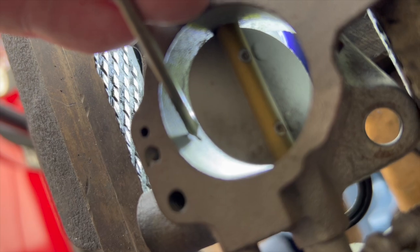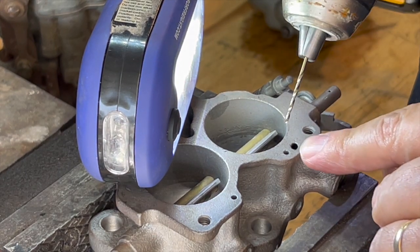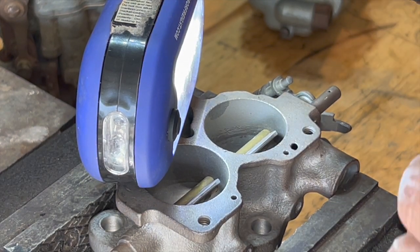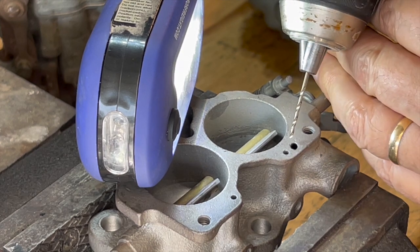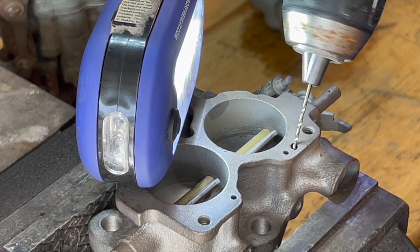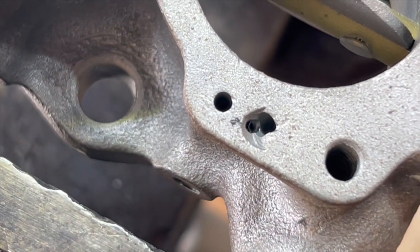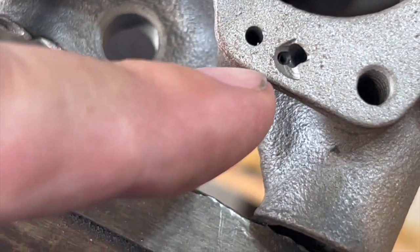You want to make sure you don't have any JB Weld sticking out that's going to be in the way of your threads for your adapter. Just about a pea-size drop of JB Weld in there — make sure it's all smoothed out so it won't get in the way of our adapter going into the bore. The next part is probably the most difficult, and that is to drill a hole straight down through this port right there. You can tell I've got a light back there, but we're going to go to that port right there, so we need to go straight down. I start with the 1/16th, a smaller bit, and go in at an angle first to create a divot. I've started the hole — you can see it right there in the middle.